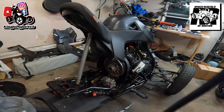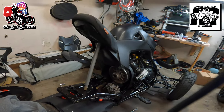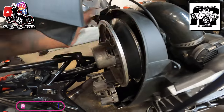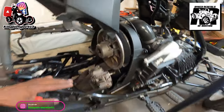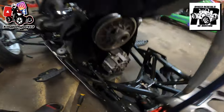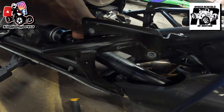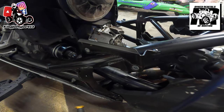After I noticed that, I noticed the belt — the belt was missing chunks. Kind of crazy that it was missing chunks. I noticed this bike was being ridden with none of the protection that goes inside here — the shroud that goes in here was missing as well, including the heat shield that goes in the bottom. There's a heat shield that goes down there to keep the exhaust away from the belt so the belt doesn't start getting messed up — that's what the heat shield is there for — and that was also missing.